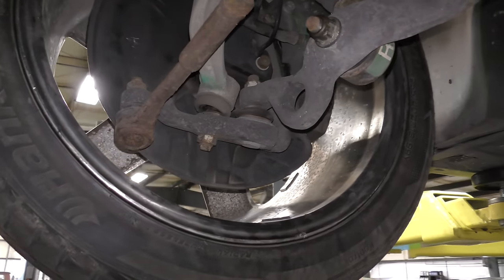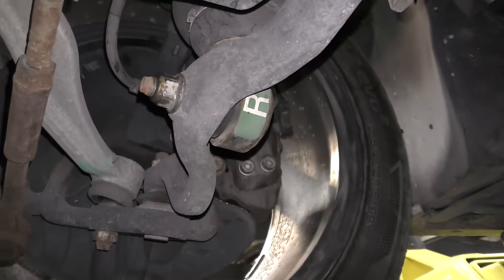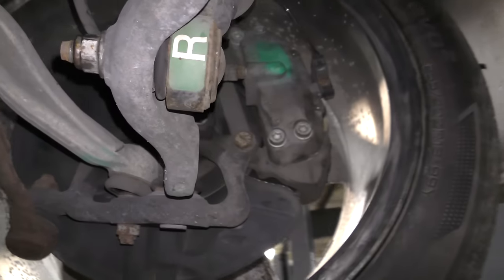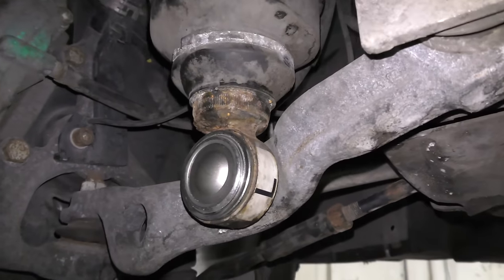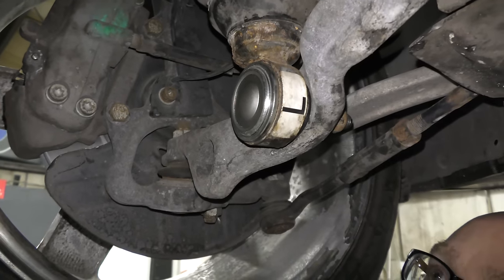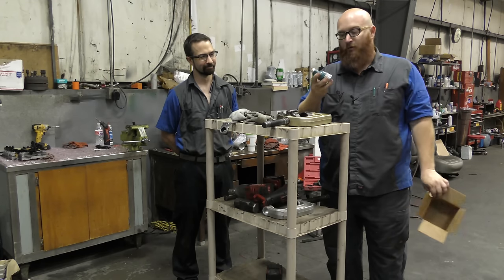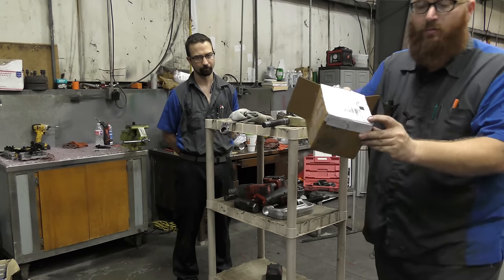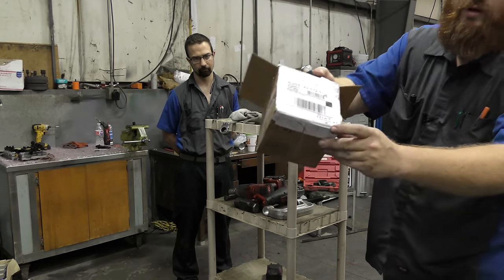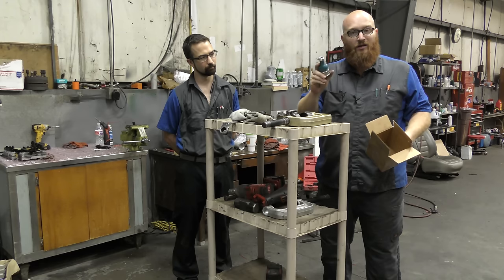In the previous video we did with Mrs. Wizard's SL500, we showed that these ball joints on the ABC struts are bad — and that's a lot of clunking noise when you're going down the road, very annoying. Over on the other side I've already replaced it with a brand new one — no movement at all, all nice and tight. You really can't find these at your local parts store or FCP Euro. I actually got them from a company called Rebuild Master Tech. I think they were $70 or $80 a piece — not too expensive — but you're able to get them if you go through the right vendor.